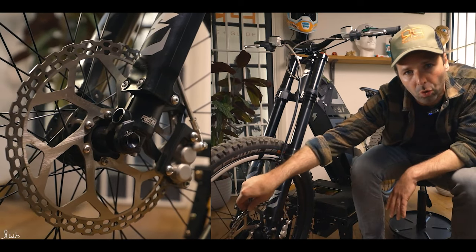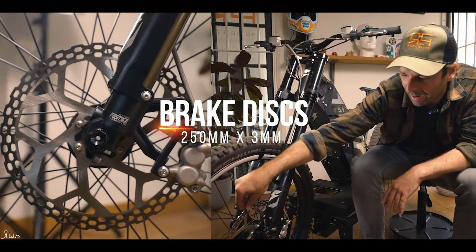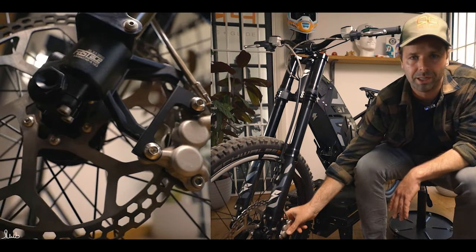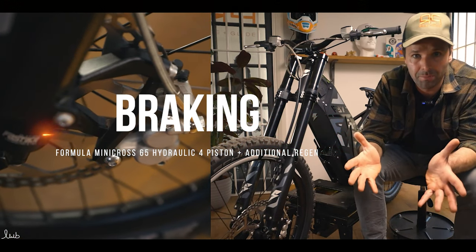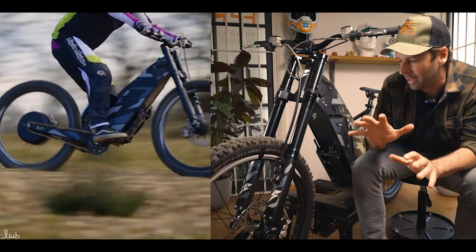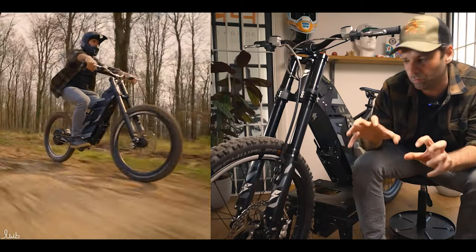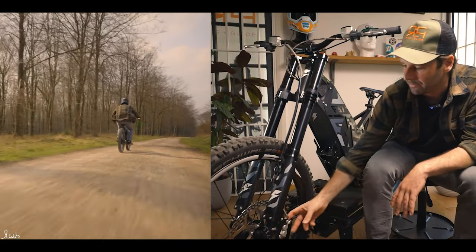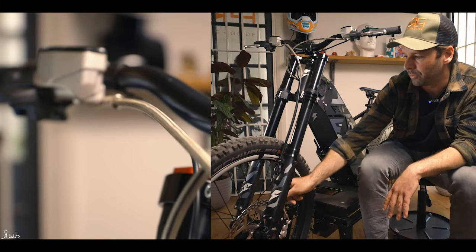You can see this enormous brake disc — it's 250mm by 3mm, so you're not going to get that bent. It's absolutely massive, and massive for a reason: biting power off that big rolling radius. We've got motorcycle grade brakes — Mini Cross 65 four-piston hydraulic brakes made for dirt bikes and pit bikes. With these they stop a heavy vehicle with ease and they're going to last longer. You've got the braided cable which stops expansion and contraction when the oil flows through it when it gets hot.